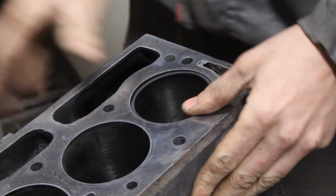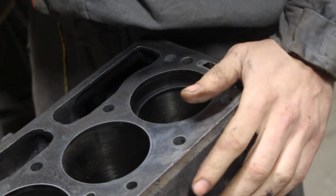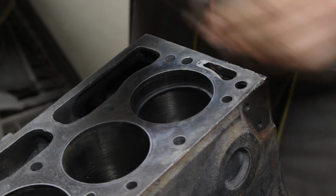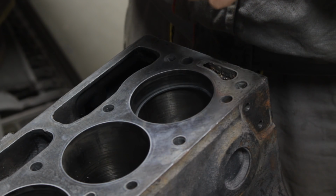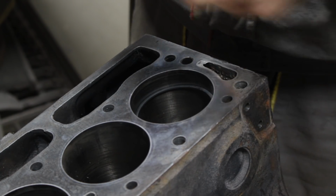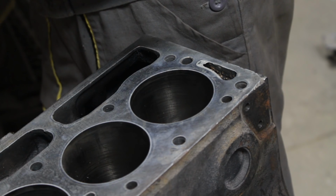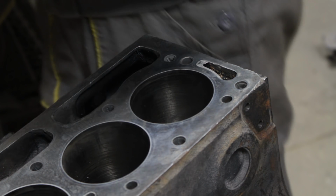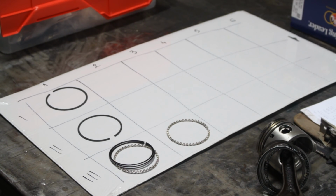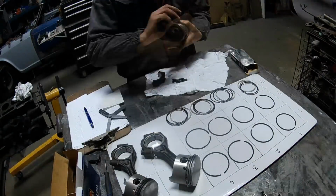So with that done, I started dedicating piston rings. I was measuring the gap in position, and once a ring was fitted into a cylinder, they became a couple, as I said before, and they couldn't be divorced anymore. I found which were the biggest rings, because there was a little bit of difference, and I dedicated them for cylinder number 6. So with a little bit of playing, this ring goes here, that goes there, I managed to fit each and every one into a cylinder and still remain within the tolerances. And this super high technology digital Excel worksheet helped me keep all the rings separated, so I don't mix them up until I assemble them on the pistons. And the actual assembling on the pistons took just a couple of seconds with the help of the time-lapse technology.